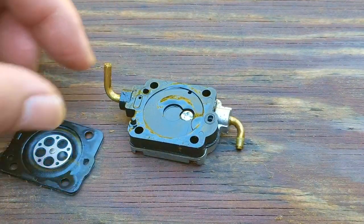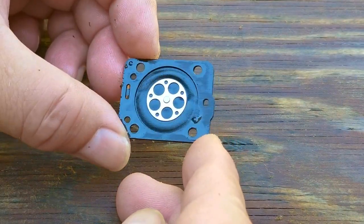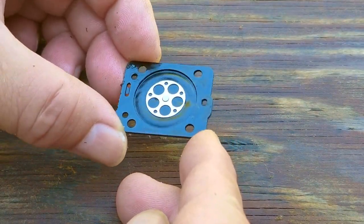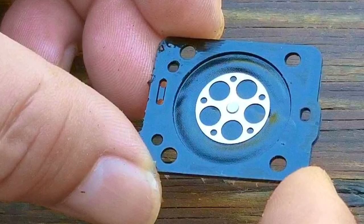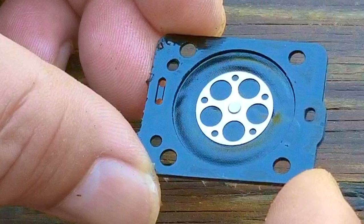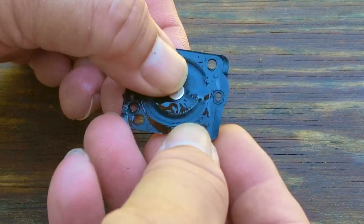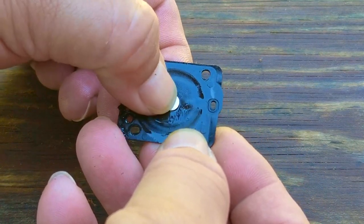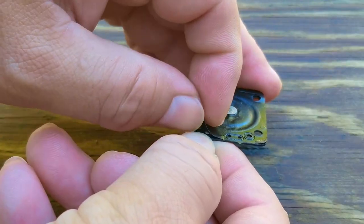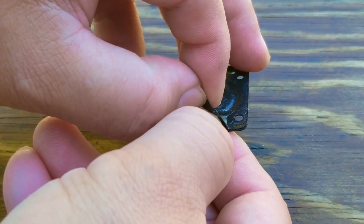After removing the diaphragm from the pumping section I can see I'm in a lot of trouble — this diaphragm is special. A typical diaphragm doesn't have all these extra small openings along the edges. The reason it has these extra holes is because the carb itself is special, which unfortunately makes it unique, and unique makes it expensive and tough to source. Thanks to online markets, sourcing the parts isn't as tough as it used to be, but the prices will still get you.